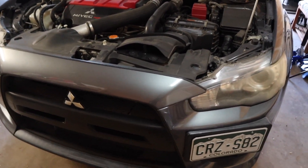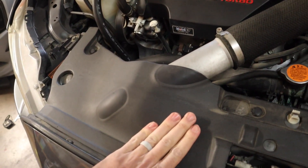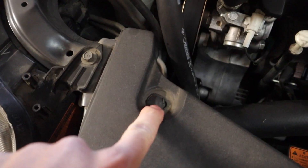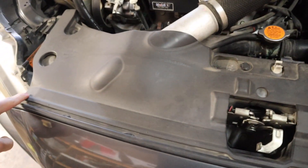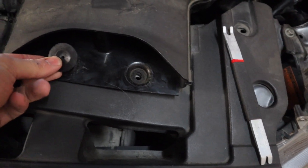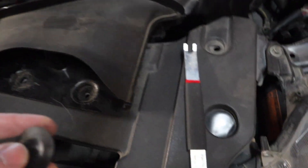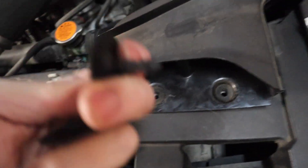Quick overview of everything needed to remove the front bumper: there's a plastic cover piece below held by pop clips — one on each side and one more — which pops off to access the four 10mm bolts holding the front bumper. I also forgot about two clips holding the air intake down; those were a pain to get off. I had to use a pry tool, wiggled them, and yanked them out.